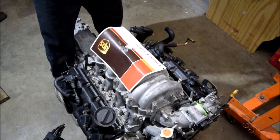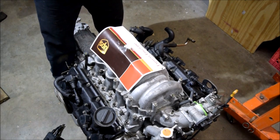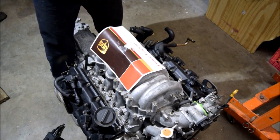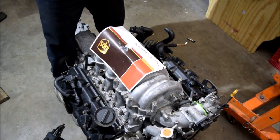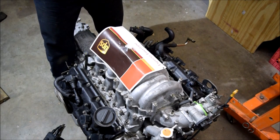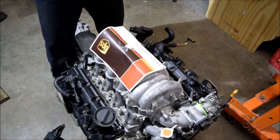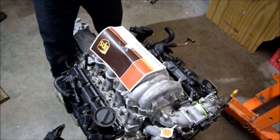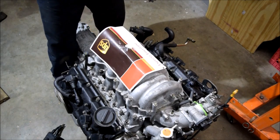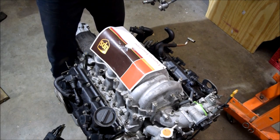You're not trying to drown this thing in lube — just a thin coat. I know it's not official or professional assembly lube, but it's better than nothing. My preference not to use WD-40 on the way in is that it's more of a cleaner than a lubricant in this case. I don't want to cause any further breakdown of anything in there. We're done cleaning, so everything should be dry right now.